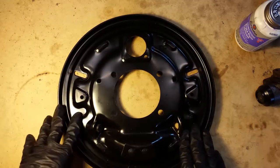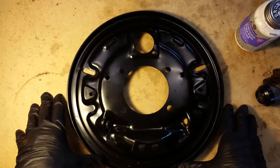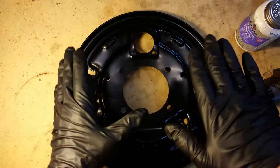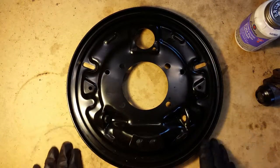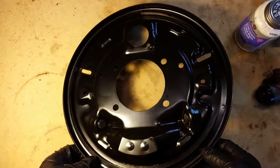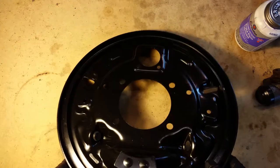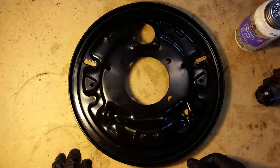If you suspect your backing plate is torqued, bent, or just old and nasty — even a brand new one may have a little bit of tilt — but if it is really non-symmetrical, like if it feels wobbly other than the normal part, and everything else is not flat, it's probably bent and there's really not much you can do to fix it. These are not exactly cheap — $50 to $60 a piece — and usually you have to buy them in pairs. Your backing plate could be the problem of why your rear brakes are hanging up, overheating, or sticking.